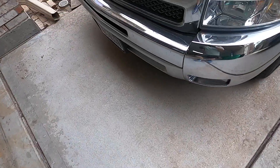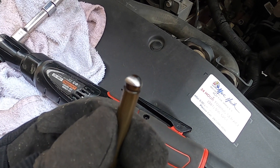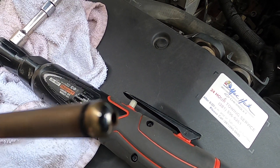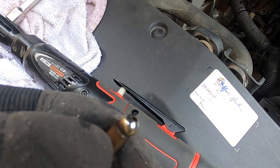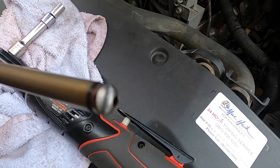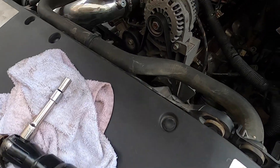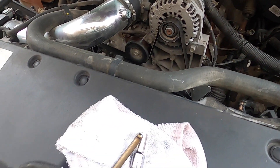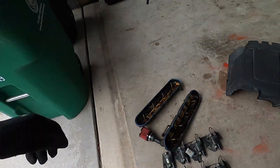Got it torn down — the first one I pulled out was just like what I was talking about. Hope you can see this. Can you see the end of that ball? It's all worn down versus this one which was on the lifter side and it's pretty well worn too. I don't know what the cause is — like I said it's not an uncommon problem. I'm going to swap out all these push rods and hope for the best. I don't know about the rocker cup but I think we're just going to run it as is — it lasted 130,000 miles.